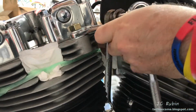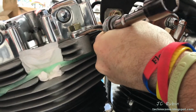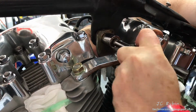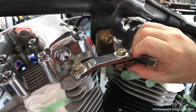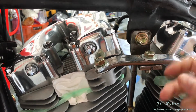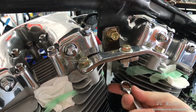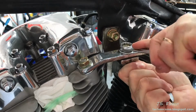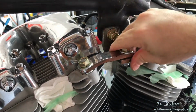We'll butt up everything against each other, making sure everything is flush, and then we'll start tightening down just a couple turns so that we can reevaluate. With everything pushed together, if I can push that bolt up and down freely, it tells me nothing's binding. I continue to torque it down significantly tighter and recheck. Seeing no gap here on the side, around, or below, with the nut being free and this being torqued, I can now add the nyloc nut on the bottom. And this will be tightened down really tight. Finish off this one really tight. And that completes the top engine mount.